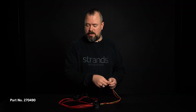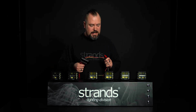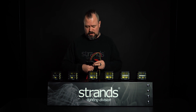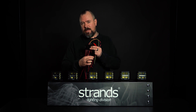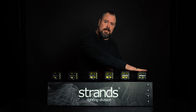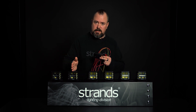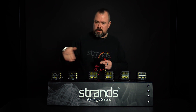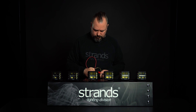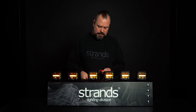I've pre-mounted six lights on a demo stand just to show you the different patterns. Here I connected the outer channel to the outer light — I could easily use this outer light instead. It doesn't matter; what's important is that the second channel comes in the light after, because the patterns will move back and forth. So now we will connect this, and we start off with the steady pattern — it's the last one — and then we move on to the first one.